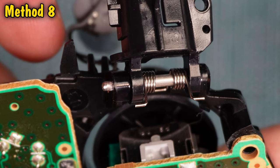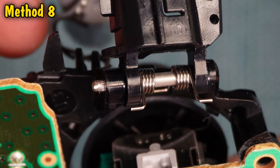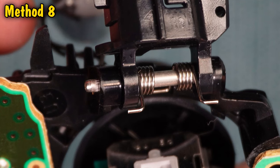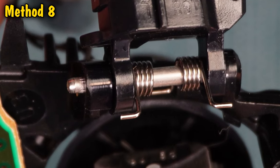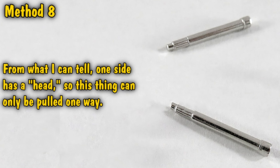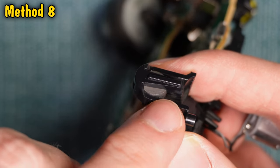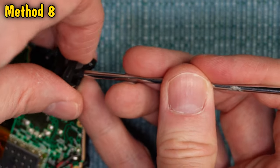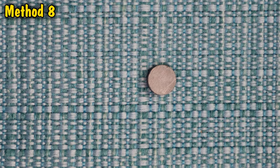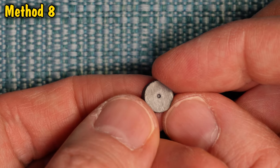You need something very small and strong to push on one end of that rod. One suggestion is to squeeze the plastic around the rod with pliers to distort it enough to loosen its grip on the bar. Bear in mind that once it's out, you have to loop it back in again — it's just as painful to get back in as it is to get out. Regarding the magnet: on my two models it's held in by a tab. If your magnet is sliding or has fallen out, tape or glue it into place. Note that the side with the little hole in it was the side facing downward toward the board.